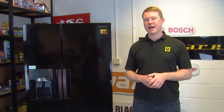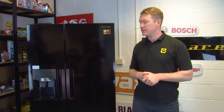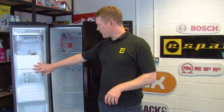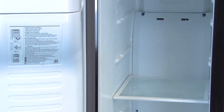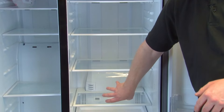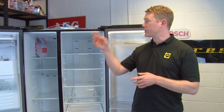The first thing to check are the fans. Depending on your model number you may have two or three fans on your fridge freezer. These are evaporator fans that are usually found inside the freezer compartment, and on this model an evaporator fan that's located in the fridge compartment, and a condenser fan which is located at the back of the appliance.